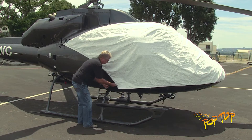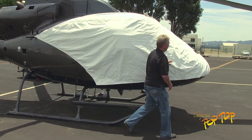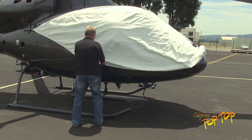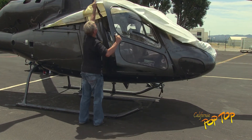To pre-flight the aircraft on B-3 models without removing the cover, unbuckle the strut strap and raise the cover over the nose. The pitot tube will prevent the cover from slipping off. Open the door and you now have access to the cockpit.